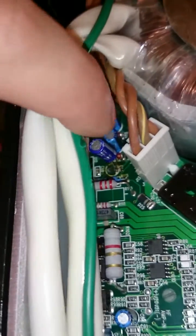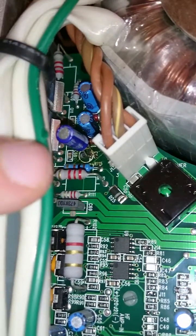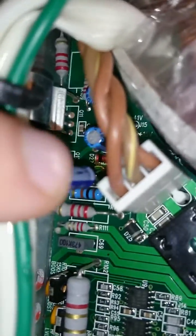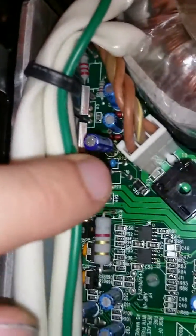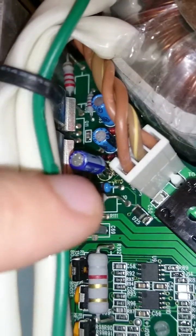To get to it — they normally sit flat on the circuit board, so you can see how the legs are just over there. Just rock the capacitor back and forth until the legs break off, get your soldering iron, and then you can melt the solder out and put the new capacitor in. Just make sure the polarity is the correct way around — the negative side is the right hand side. You'll need to remove this cable as well; just push the plug on the back and then you can move it out of the way, which you'll need for your soldering iron. So that's it — just take that capacitor out and put the new one in. If you still have trouble then you might need to do the next one, but this seems to solve everyone's problems right here.